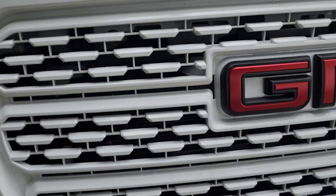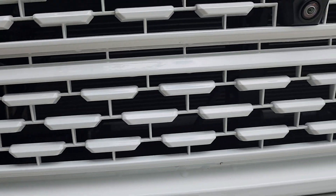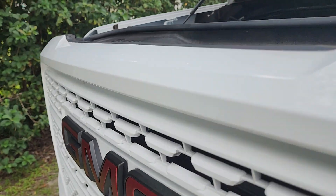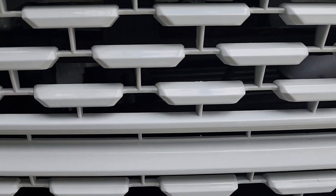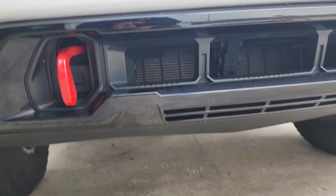On the GM side, you have to leave at least one or two blades. I think I only have two blades left — the camera probably won't focus on them — but there's almost no blades left. You can see the radiator and there's nothing obstructing the airflow. That leaves the transmission cooler getting a full blast of air, and when I install the aftermarket PPE transmission cooler very soon, it's going to perform at its absolute best.